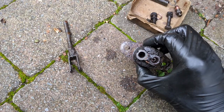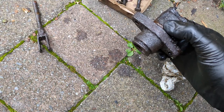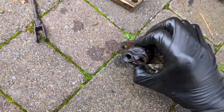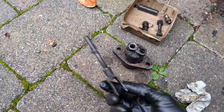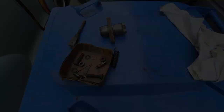We'll see properly when I remove the piston. With there being no dust boots, that will have allowed moisture and damp to get in. My concern is: what condition is the bore? All will be revealed shortly, because that will depend on whether I can do it myself or if it needs sending away for sleeving. The push rod came out alright — that's looking in good order and will respond well to a clean-up, which is what I'm going to do next: get everything degreased, nice and clean so I can work with it.